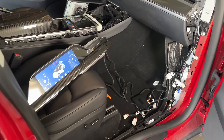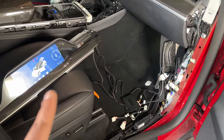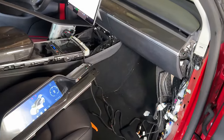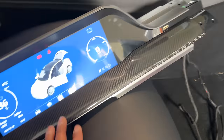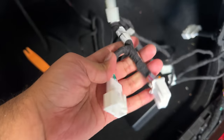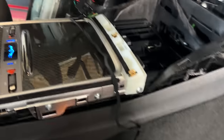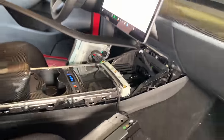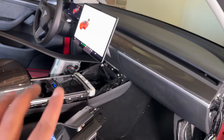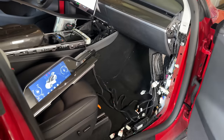Now let's talk about the AMD wiring. On the AMD one we have one extra step, which is to connect to the power. We got a computer connection coming from here, plugged into this box. The other plug directly connects to the screen unit. Then there are extra Intel plugs — since it's AMD we're not going to need those, so tape and hide them. There's one cable that we're tapping into the front wireless charger to get power. On the first version, we had to go to the front battery and connect it — you'll still do that, but this is much easier.